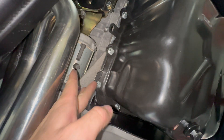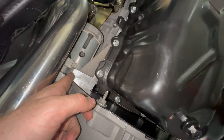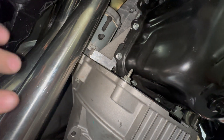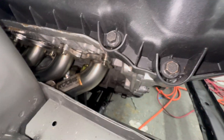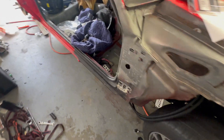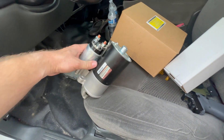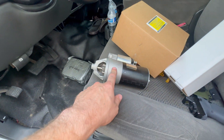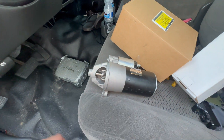Off camera, I went ahead and put the starter in. I obviously have this bolt missing because I have the wrong bolts here — I reused the clutch bolts just to get it in place, then I can swap them. I did have to take out the exhaust pipe that wraps around — the slotted one on the passenger side — to get the starter in. According to Cook's website you want to use this specific starter, but it was bigger than the factory GT starter that came with my car, so I'm just going to reuse the original one and return this.